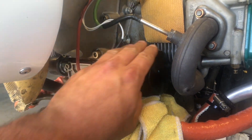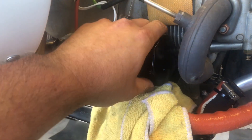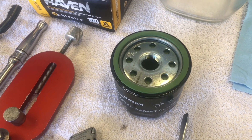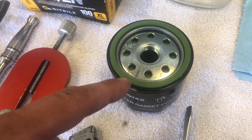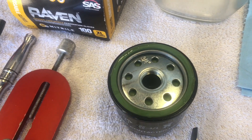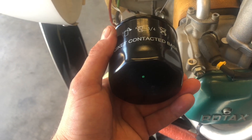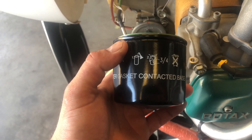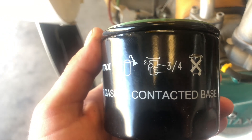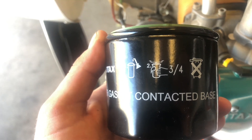Now that the oil has been drained out of the sump and the filter is being removed, make sure you do not rotate the prop until the new filter and oil are reinstalled. Get your new oil filter, put a small drop of oil on the sealing lip, and ensure it is properly lubricated. Unlike a conventional aircraft oil filter, the Rotax oil filters don't have a provision for putting a socket and torquing them. The instructions indicate to lubricate the seal, thread the filter on until seated, and then continue another 270 degrees — three-quarters of a turn — past being seated.